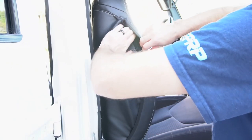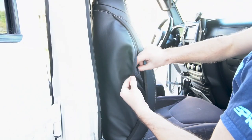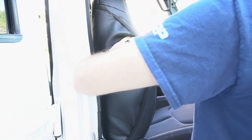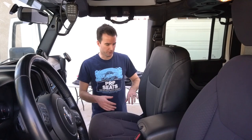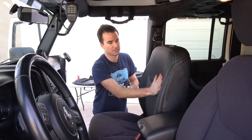All you need to do is take this material, tuck it back in, and especially make sure this soft material is laying up over the side and under the front of the seat. So you just kind of work your hand through and tuck it around. Once you've gotten the cover mostly on, it's always good to work your way around, pull and push, basically tighten it out, and make sure the cover is sitting on there flat. If you're having a lot of trouble with the material and there's still a lot of wrinkles in there, put it out in the sun for longer.